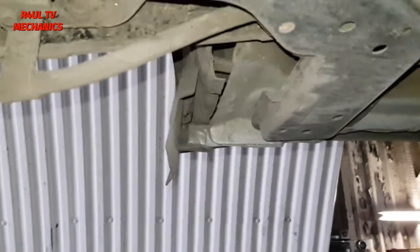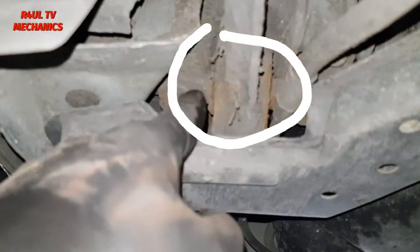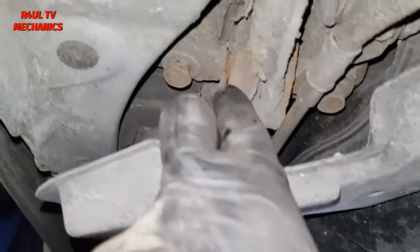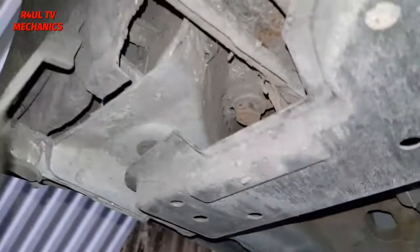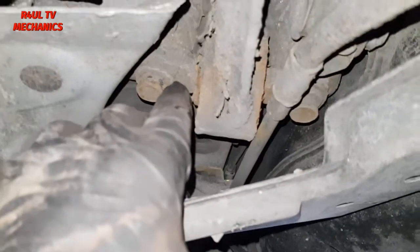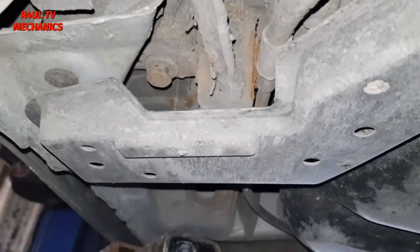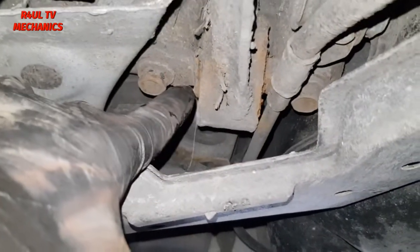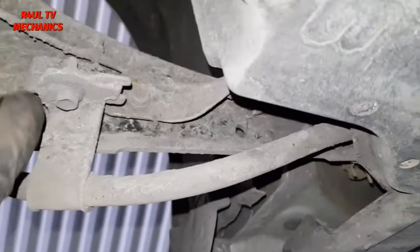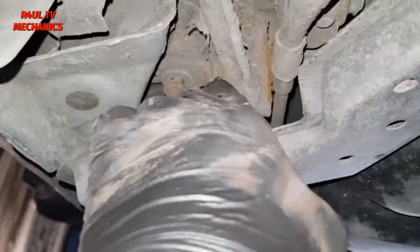Right, like I mentioned, there's two ways to do this. That's the bush in question there. That's the one we're going to replace, this bush with the two bolts going through it. Two ways to do this. One is you buy the bush separate. That's what I've done, I've just bought the bush separate from eBay. I'll put a link in the description so you can see where I got it from. And take this arm off, this leg off, and then just replace the bush itself.